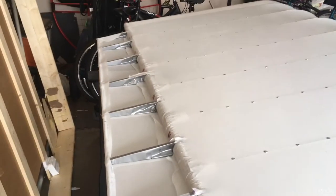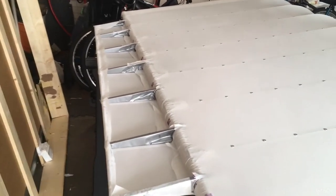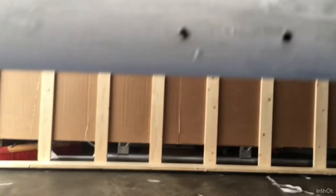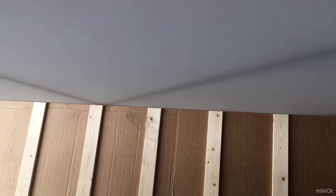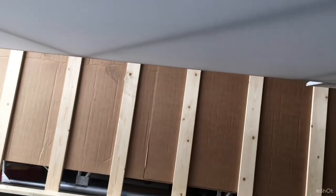Holes are poked again for the hinges. I just have to cover the trailing edge ribs right here. What's left? Cover this and wrap the aileron. Oh — I know what the other thing is: I've got to poke holes for the struts. I have the holes, but I've got to come underneath and cut holes in the bottom where the strut bracket is going to come down, and then on the back side — that's the one that's at an angle — that faces the inside of the airplane itself.